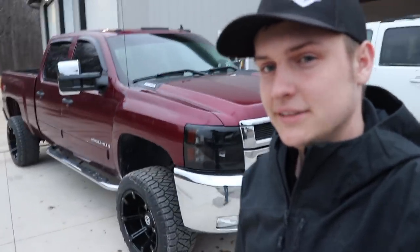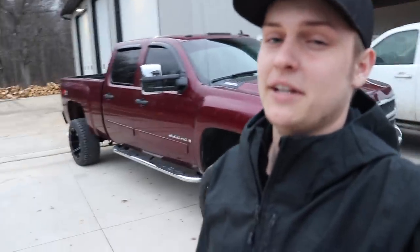Turns out the Dodge is already lifted — not really an out-of-the-box kit, but somebody put a bigger coil up front with a spacer and a five-inch block in the rear. So that truck really doesn't need another kit. We are going to buy some upper and lower control arms to push that front axle a couple more inches so it's perfectly centered and she can clear those tires perfectly. Her truck looks awesome. We're also picking up another dually build. That's gonna put a wrap on this video — thank you for watching. Don't forget to enter the 2008 LMM Duramax giveaway ending in three days. Every $15 you spend is another entry. Leave a fat thumbs up, comment below, subscribe if you're new, join the team, join the family, and I'll catch you in the next video.